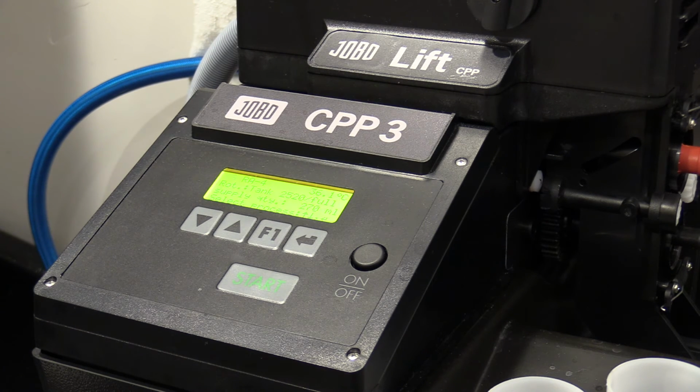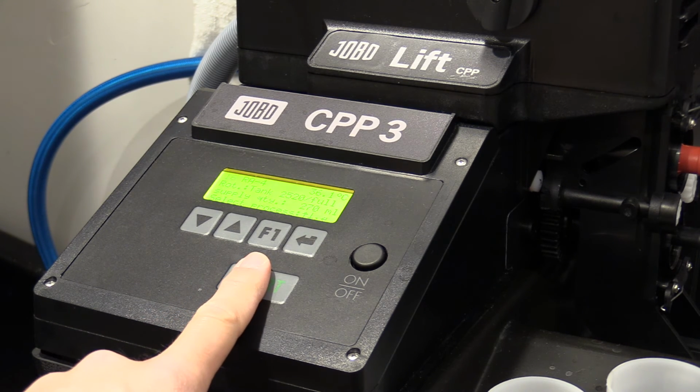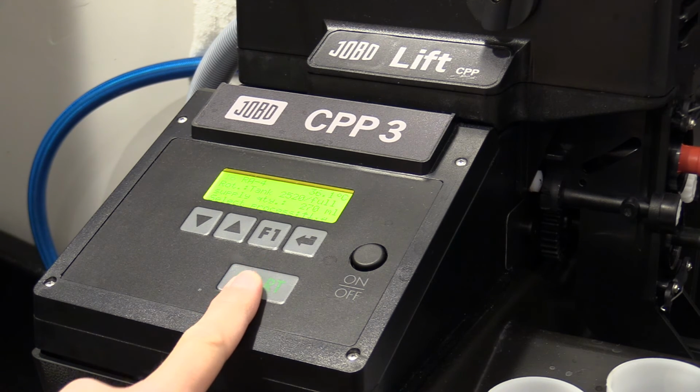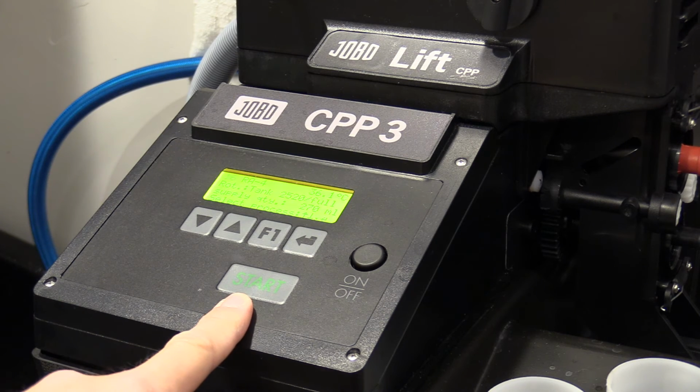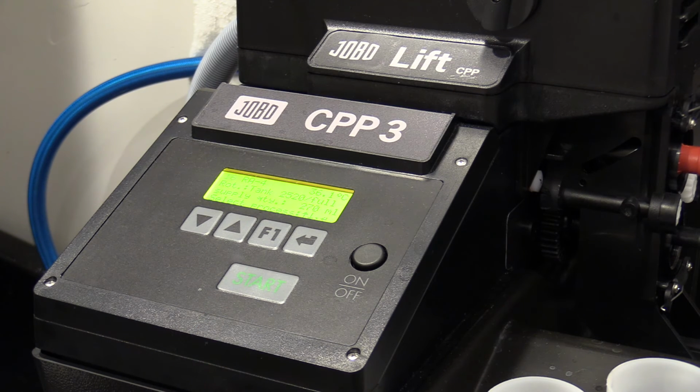During a wash step, pressing start will stop the motor only when the message "replace water" is displayed on the screen. After dumping and refilling the water, pressing start will cause the motor to start again. Since the timer never stops during a wash cycle, you do need to be quite quick in how you manage all of this.